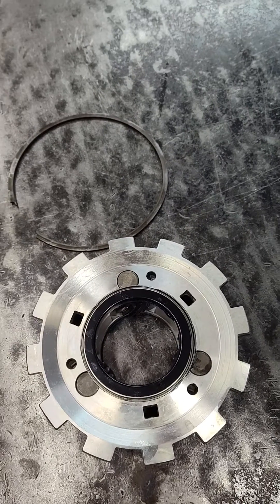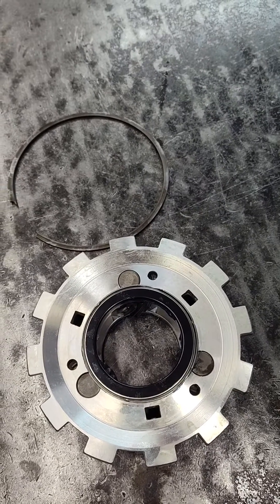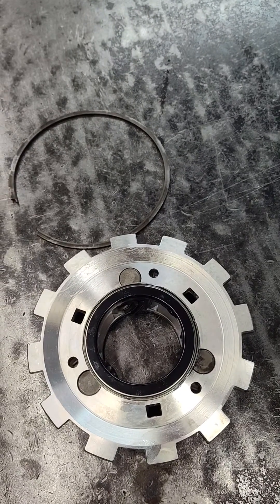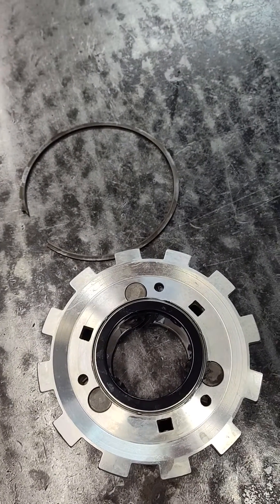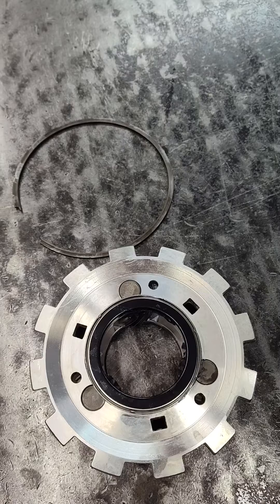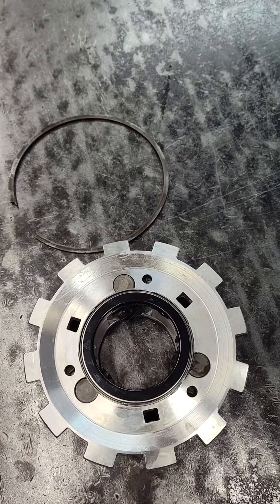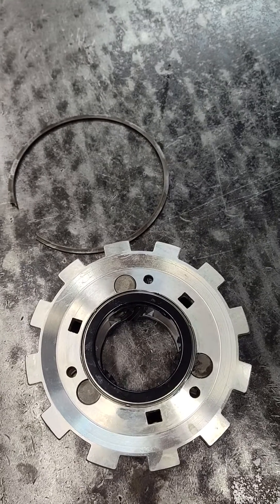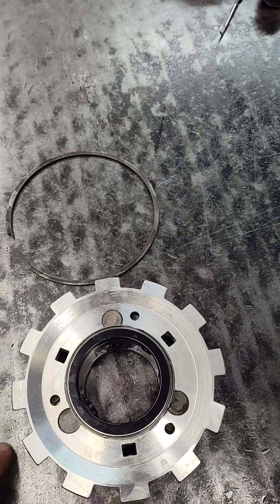Six-pinion I've used in some tractor pulls and things like that, but don't get caught up in that. This transmission I'm building is for a big-engine drag car that's also a street car, making a lot of power, and this three-pinion is going to be just fine. The reason I'm using it isn't to be cheap — drag racers want to reduce drag, which is what our bearings here do, and they want to save weight. If you're burning these up, you've got an oiling system issue or something else going on.